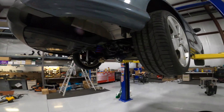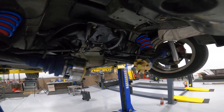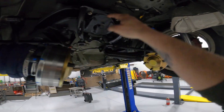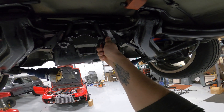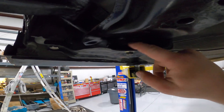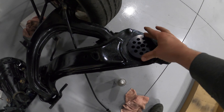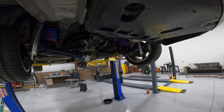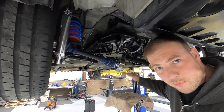Back over on the car — I'm going to have to loosen these back up. One thing I want to point out: leave all of this loose when you do it. You just have to disconnect the axles, take the exhaust out, and there are four bolts up here to drop your old differential. You can do it without lowering the whole subframe. Put these brackets in loose to slide the diff in. We changed out to these billet-style units and also replaced the bushings with solid mount units from Hendrix — a perfect fit. All the hardware up here and the bolts coming through the sides are all 19 millimeters, which makes it easy.